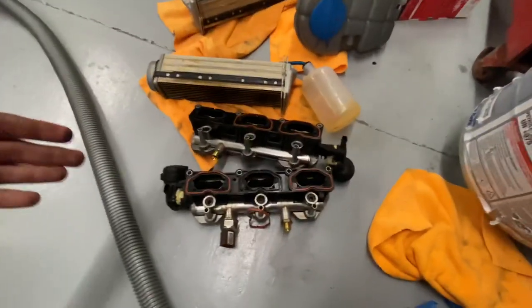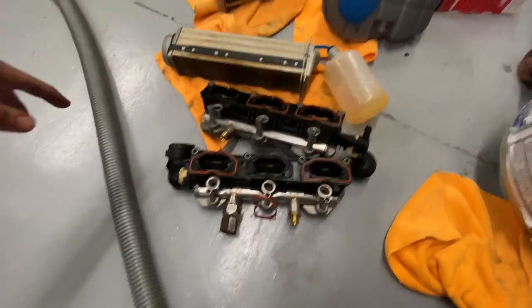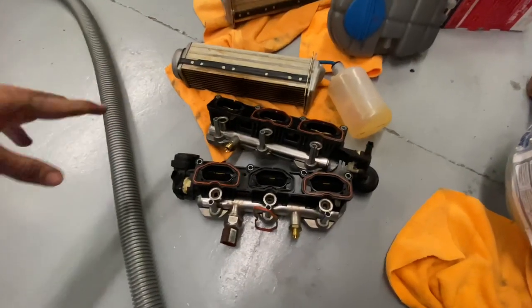The valves on this car don't look as good as I'd like — I'm not going to do a carbon cleaning right now, but I thought methanol would clean them off and it didn't. Also got these injectors off. No one told me and all the videos I watched, they came off easily. These were very difficult to get off, and I think it's because the injector O-ring was very tight. It had a good seal. I can tell someone's been in there before — prior to me they were in there frequently because there were some pretty good hack jobs going on. I saw it was a zip tie in place of a metal clamp, and as soon as I cut it, it shattered into a million pieces. It was a matter of time before it broke.